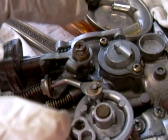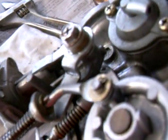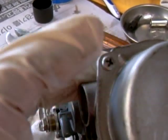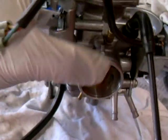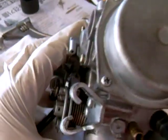You want to put some oil on that accelerator pump linkage there. There's a plastic collar washer and metal washers at the bottom, then the lock washer at the very bottom. You want to put lightweight oil — what I like to use is Lucas heavy duty air tool lubricant; it's really thin oil. For the vacuum cover, the notch would be on the left front side if you're looking at it — this side is the air cleaner housing and this side goes to your intake manifold. So you want the little notch on the top left side. Make sure you get the screws on there tight.